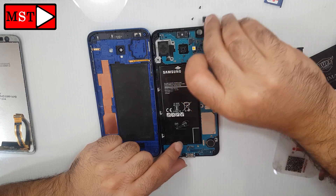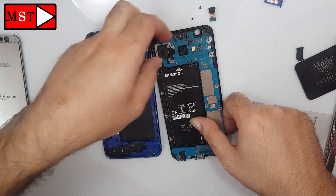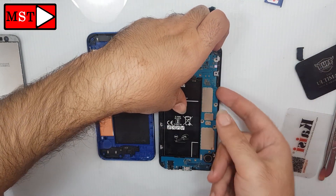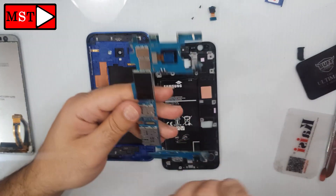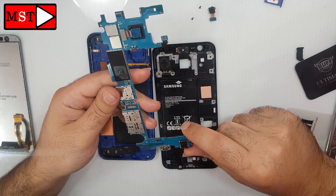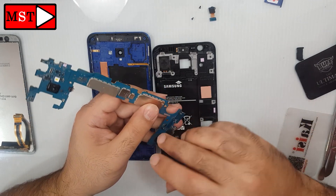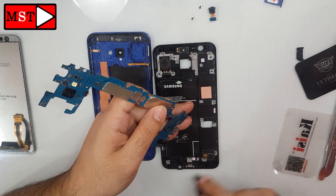Remove the camera. Now push the board out. They told me the device got water damage, so the microphone got damaged. I'm checking if there is any water leaked inside. It seems there's no water leaked inside — maybe it just leaked to the microphone and got damaged. I need to clean it either way, and then I'm going to replace it.